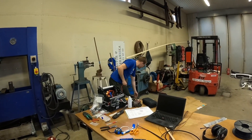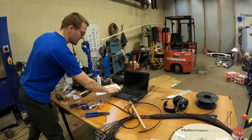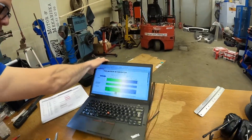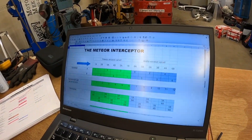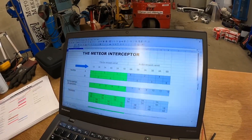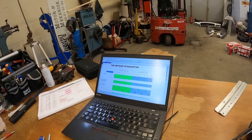You had a spreadsheet on your computer, right? Yeah, I've set up some kind of scheme to figure out how to wire the cylinders. This is the ignition order for the engine — they are numbered one to six for each bank, the A and B bank. We need to set up the wiring to correspond to it. It's kind of complex, but at least once you have this set up you have something to work from.